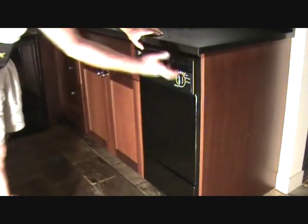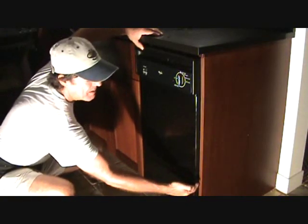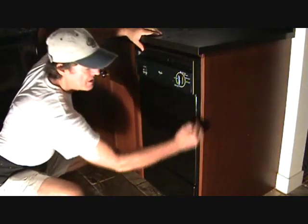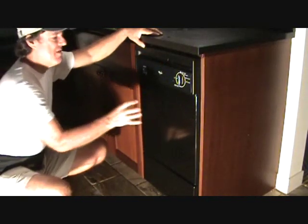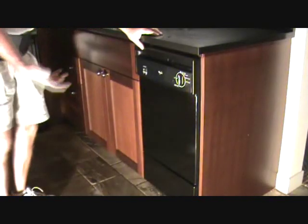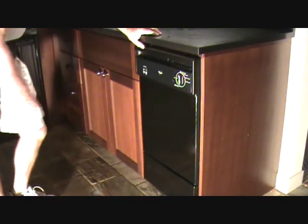And so if that happens, you turn on the dishwasher, you might see bubbles and water coming out of the bottom right-hand corner or the bottom left-hand corner. And that's because your seal's not tight, because your dishwasher's been loaded improperly and you've got a slight bind in the front area. So sometimes it might be as easy as that. So check that out first before you call an appliance company.